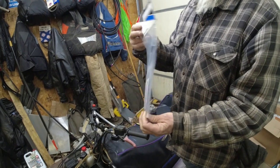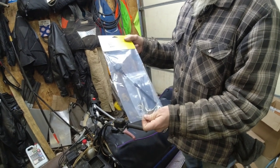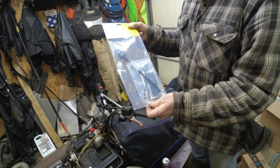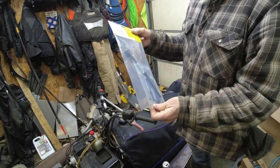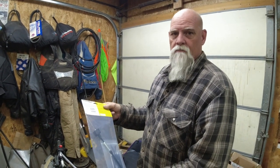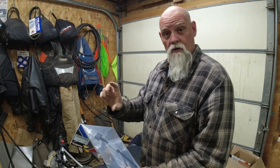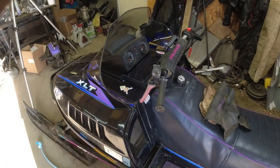Power Mad, Wyoming, Minnesota. Lonnie, when we crank Lonnie's bars, the motor would rev up. So that's a 10-inch throttle extension that we're adding into it right now. And that should take care of that. Yes, it should. And if I ever do decide that I want to go to the taller bar, the taller riser, I'll have the extension. All you need is the bolts. Oh, yep. We got the bolts. You could do it anytime. Yes, we can. Cool. All right, so that's it for Lonnie's sled.